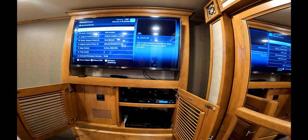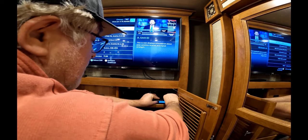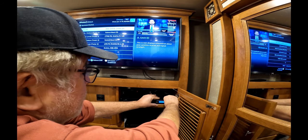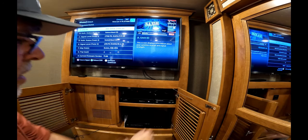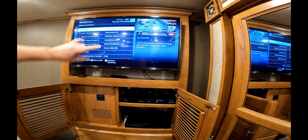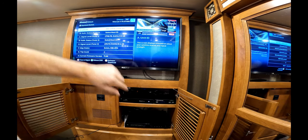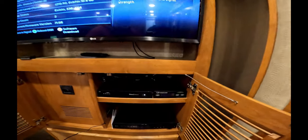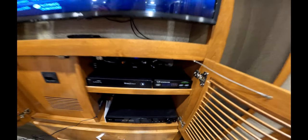If it's quiet in your RV you can usually hear the motor turning so you know it's going into search mode. There we are - we've got a signal of 98 and 92. I hit Power and Select and stopped it. This happens to be a PVR so we've got two lines - signal of 98 and 92. Hitting the Power and Select button on the traveler controller box powers it off and stops the search mode, so now you can watch TV.